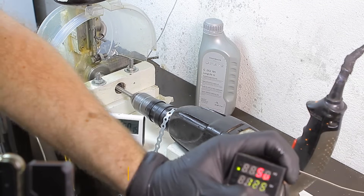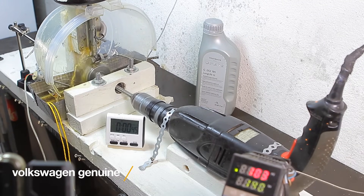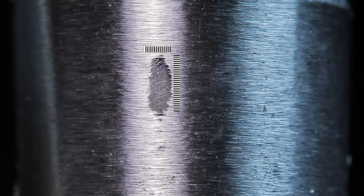I was very curious about normal engine oil in this test setup, so I decided to use genuine Volkswagen oil with 5W30 viscosity. Holy shit — that's a big scar. When I tested this oil under normal conditions the scar had 1.46 mm², but now using the higher temperature setup the scar measured 2.896 mm², which is a 98% increase. Using normal oil under racing conditions is not a great idea.